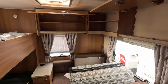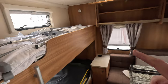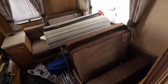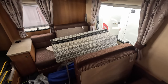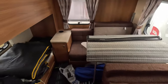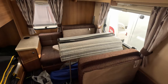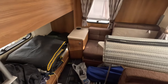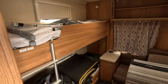The rear of the caravan is no different. The lockers will remain open. Where there are no curtains, I'll just use the two blinds for the top and the bottom. I've lifted some of the seating here to get some airflow. You do need to be careful about anything you're storing in here that may have got damp over the last few weeks and months. You just need to make sure these are 100% dry. You do not want any items — your awning, porches, chairs — to be wet in any way. They need to be dried and aired out prior to being left in the caravan. This is what the rear will look like whilst it's being stored.